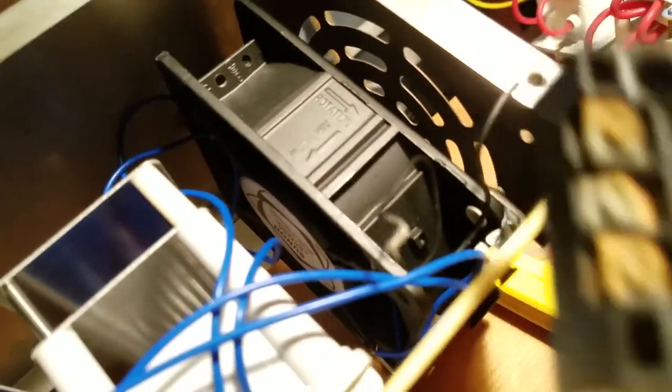To be able to plug it into the wall, because this is the wire that goes to the wall. It's a 120-volt wall outlet plug. I gotta hook these up appropriately, because these are both blue wires, I gotta do right and left. So, this is a left. Left wire and left wire, these are the two left wires as they come out of the transformer body here, going over to the power from the wall.